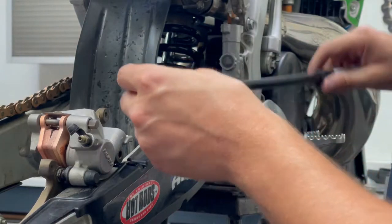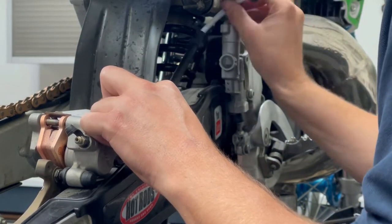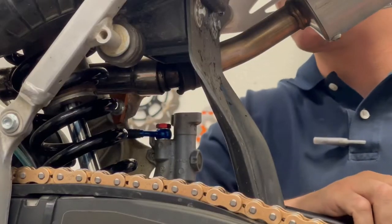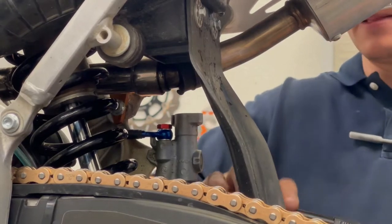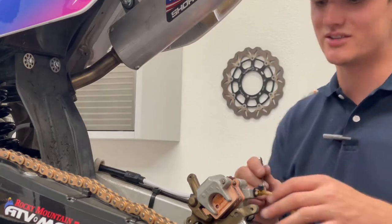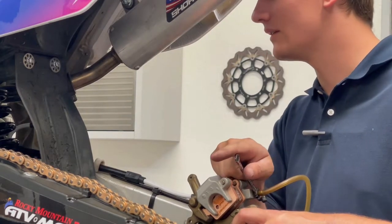Installing your rear lines is super easy. Simply start at the rear where the caliper is and work your way to the front first — we found this the easiest way to get your cable inside the guides and get everything lined up. Torque your banjos to your factory recommendations in your owner's manual. Evacuate your system of all air, introducing your new Dot 4 oil.